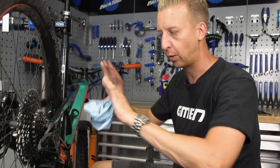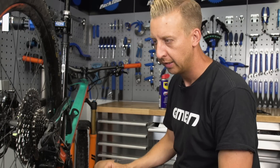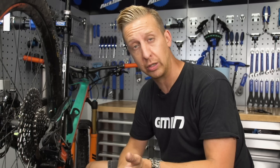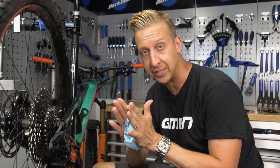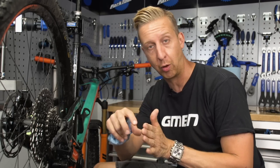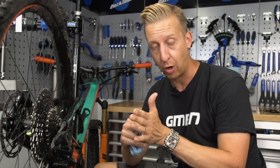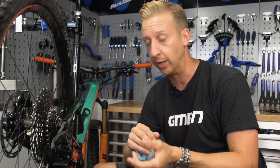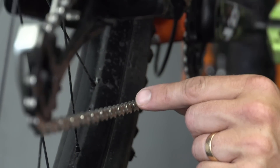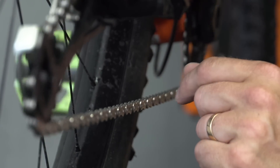Now we've got the bike inside, giving it a quick wipe down so it's not too wet. Now it's just a bit of fine detailing and obviously inspection at the same time. What you're looking for are any sort of chain plate that might have started separating — that's the key to a snapped chain. In each chain you've got the outer plates, the inner plates, the rollers and the pins that go through them. If those pins aren't connecting properly to those outer plates, when you pedal hard your chain will snap at some point. So it's always a good idea to just focus on one area of the chain and watch the chain go by as you inspect it.